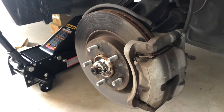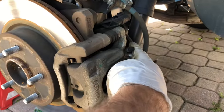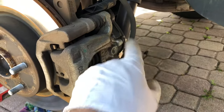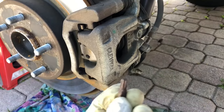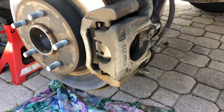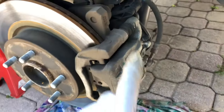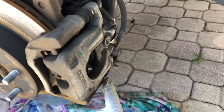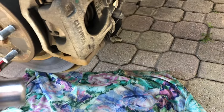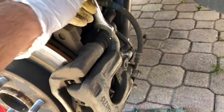So I'm going to film that one. This is the back — this has the electrical brake, so I'm going to have to take it down. There's a screw here and another one on the other side. It's a T30. Then I'm going to take this off — there's a screw here. It's half an inch.